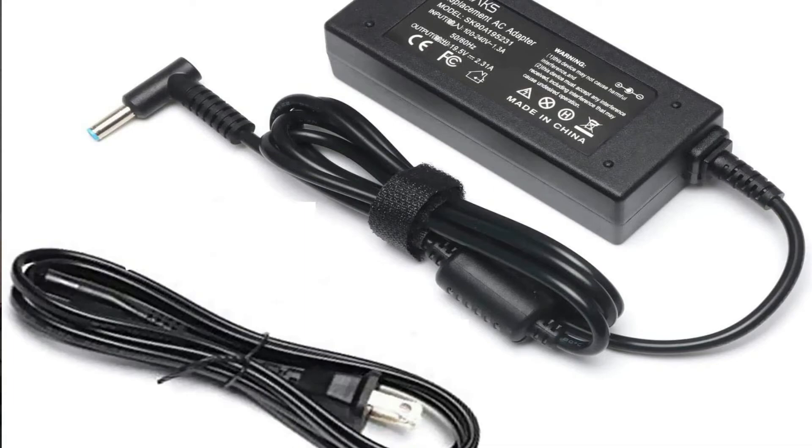Now, if you've ever had to wiggle your cable to just the right position to allow it to charge, this is your problem. So what's the fix? Well, ideally you want to make sure that it is not your charging cable that actually is the problem. So if you have a second or backup cable, definitely try that. Most of the time if it wiggles really bad when you plug it in, it's not the charger, it's the DC jack.